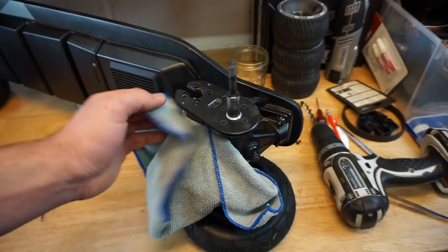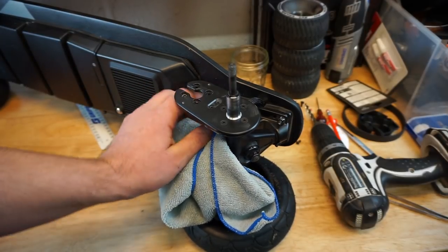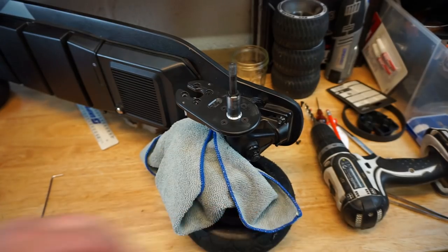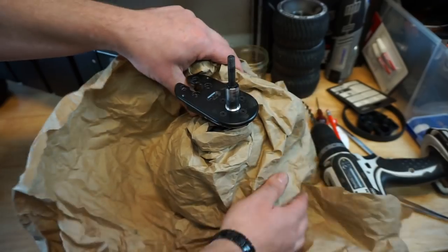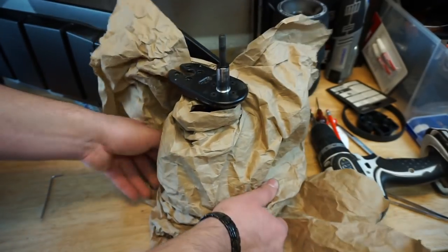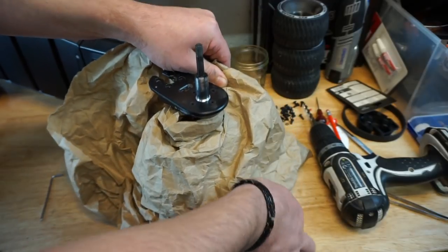On this particular board there are some lock washers used to keep the bolts from falling out, so I'm using tweezers to find them. Before you remove the motor, you need to cut this electrical zip tie to loosen up the cable — it will be long enough for you to move the motor to the side. Protect the bottom of the motor, then remove it by just sliding it out. There is a cutout in the motor mount — brilliant design. Rest it on the cable using a rag so nothing gets scratched.